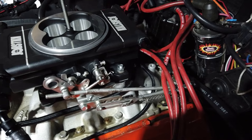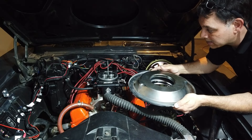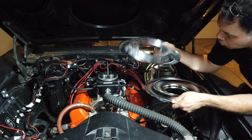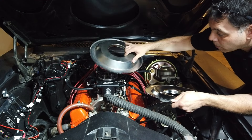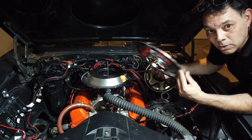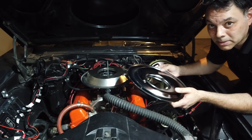When you're all said and done, make sure that the TPS — the throttle position sensor — is telling you it's at zero. The last thing you should probably be aware of is the fact that the bottom of your air cleaner might not fit the Kill Shot anymore. Originally I had a dropped-down air cleaner base, but because the bowls are so large it sits on top of the bowls and doesn't actually mate with the EFI system. So I had to go out and buy a flat-bottomed air cleaner base — just something to keep in mind, don't let that take you by surprise.